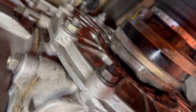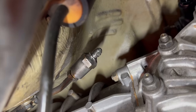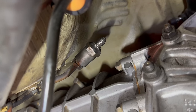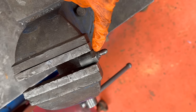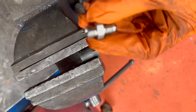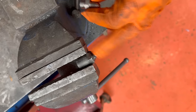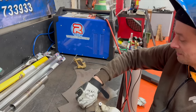Last little complication is connecting up the clutch slave. You can see up the top there is the slave cylinder, which has a dash 4 adapter coming out of it now — 4AN. Coming out of the car we've pre-adapted that to 3, so I just need to take that adapter off and re-adapt it to a 4, and simply make a pipe. Got this new fitting which is going to be shaved down and basically welded onto there.